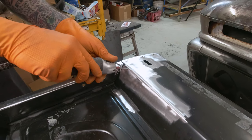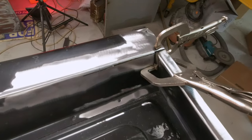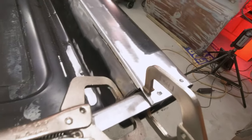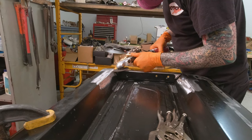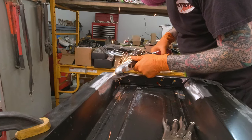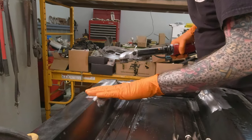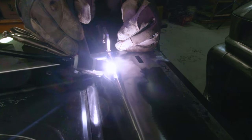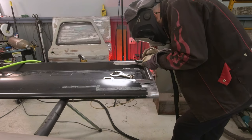After slicing each of the corners I was able to get them kind of to fall into place where I wanted them. I clamped out at the very edge of the panel and let the whole piece kind of drag down gradually. That pretty much worked on the top two pieces — it was pretty straightforward, nothing really special had to occur. It kind of just fell into place thankfully. The bottom two required heavier cuts to get them to roll in as far as I wanted them to, requiring that I clamped out at the outer edge. I tacked it out there and then tapped lightly with a hammer and a slapping spoon on the way across the cut so that it fell into where I needed it to be. Once my cuts are made and once I have things clamped in position, it's time to start welding. I'm TIG welding here because that's pretty much all I do when it comes to sheet metal work.